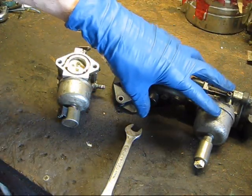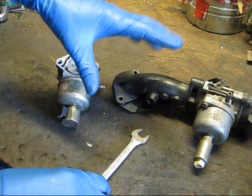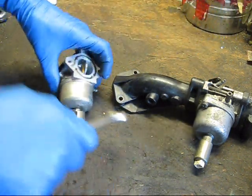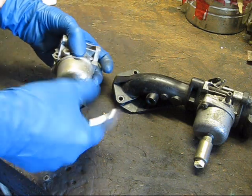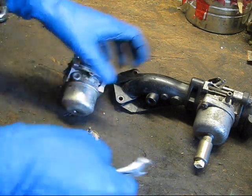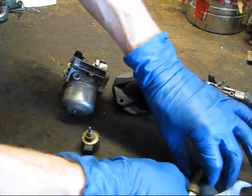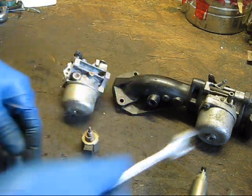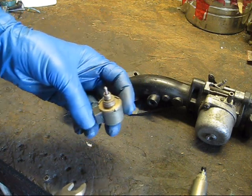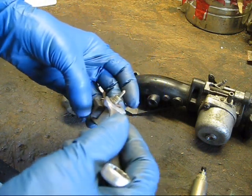So the purpose of the backfire solenoids is to prevent that backfire. The way they do that is by shutting off fuel flow through the carburetor when you turn the key off. We'll go ahead and pull out these solenoids — I'm going to pull out both of them so you can see the differences between the two. Just a tip: if you're going to be working on these a lot, this is a half inch wrench. It fits the Nikki and the Walbro style backfire solenoids. However, for these stubbier Walbro solenoids, in order to get the wrench onto the flats to get it off, you need to grind down a standard wrench because there's not quite enough space in there.